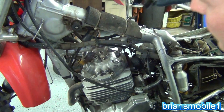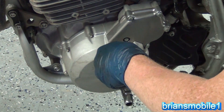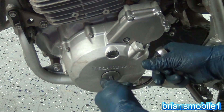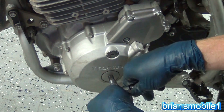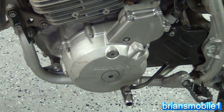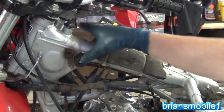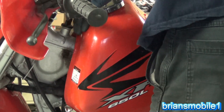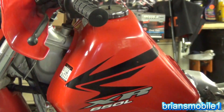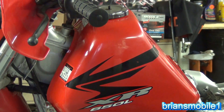These are really soft plugs — I don't know if they're magnesium or aluminum, but they're just really soft so be gentle with them. You really don't want to cross-thread this — go slow and don't over-tighten it. Now it's time to put the tank back on. It's got these grommets — make sure they didn't fall off on the ground and they're still on there. Get that big fat washer and get the screw in there. Same process as the teardown in reverse.